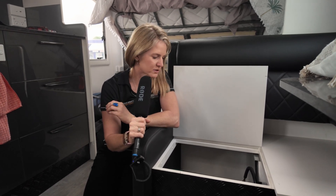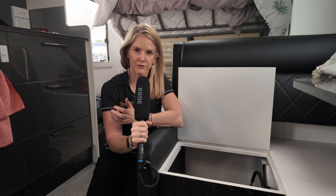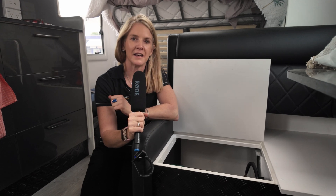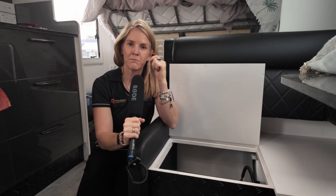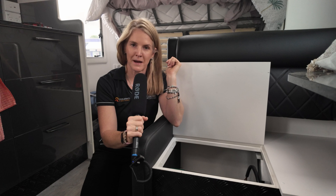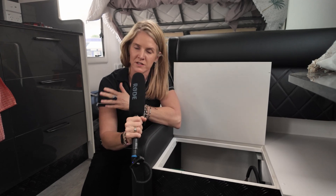All those sorts of devices — it will convert the 12 volt power stored in your batteries into 240 volt power to run all your appliances. It's a transfer inverter, and the way I explain this to people is: on pack-up, if we've been in a caravan park and we're on grid, I'm madly trying to do all my washing. Andrew's outside in a hurry to pack up and he pulls out the mains power cord — the cord that is charging all your batteries when you're in a caravan park. I've got a load of washing on but I don't know he's pulled out that cable, because the transfer inverter just seamlessly goes from mains power to 12 volt power in your batteries and you've got no clue about it. Everything just continues working as it was when you go from an on-grid to an off-grid situation. We absolutely love the 2600 watt transfer inverter and use it in most of our installs.